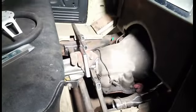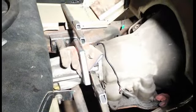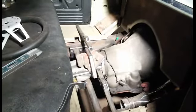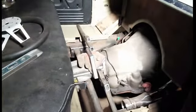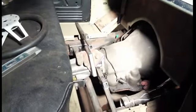So what I'm trying to do now is to take this 1 inch tubing and make a tube that goes over top of the transmission and will go underneath of the floor, and then it's going to jog down and go underneath of both running boards, and that way when you step on the running board it'll be connected directly to the cab, and that support will also support the floor and the trans tunnel, so it's a little more stiff. And that's it for this time.